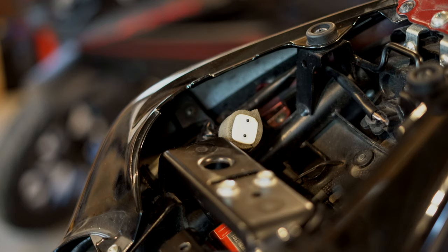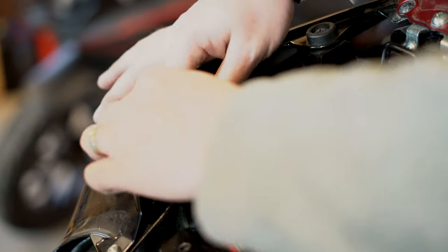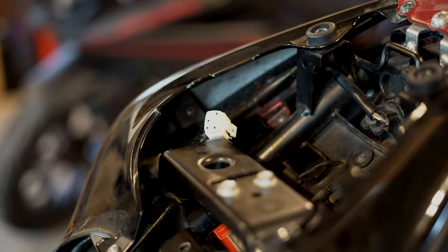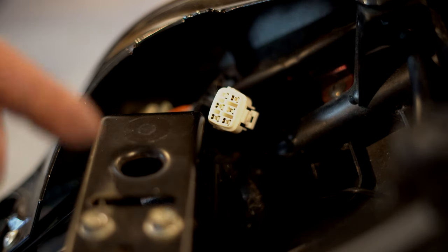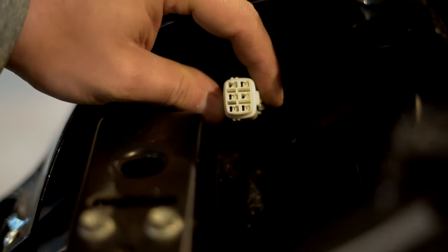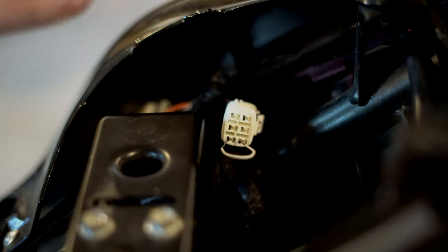For those who want to continue and learn how to adjust your TPS, we're going to move to the back of the bike where you'll see this little white housing. You're going to take the cover off. This is where your paper clip comes in — you'll see six leads on there. If you're looking at the clip with the clip to your right, you're going to want the bottom two. Put the bike in dealer mode. Now go ahead and turn the key in the ignition but don't start the bike.